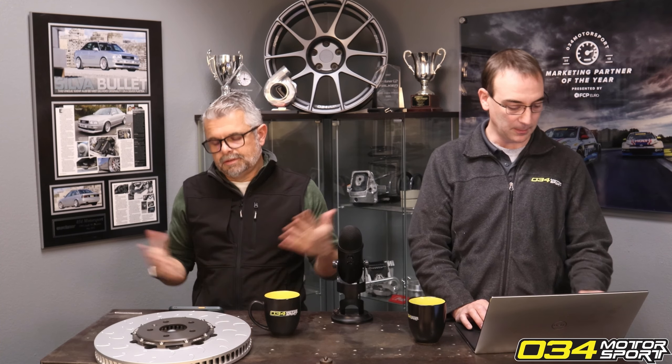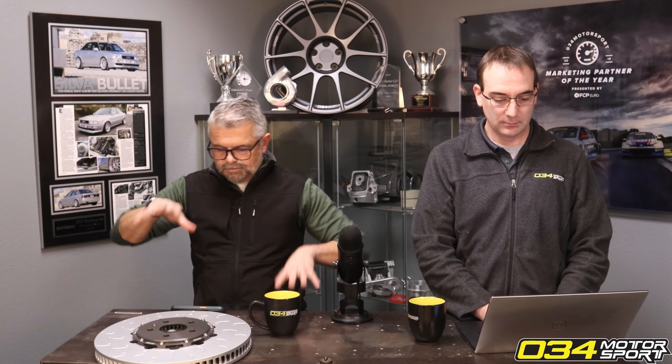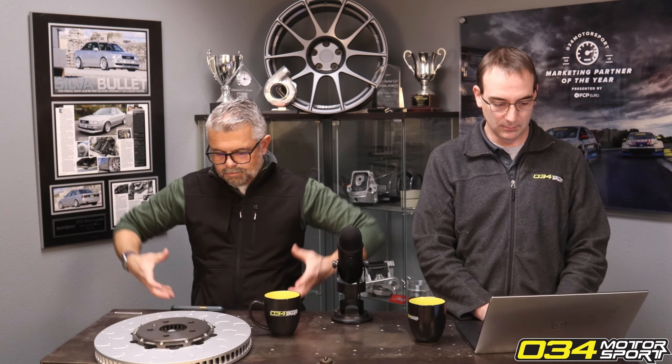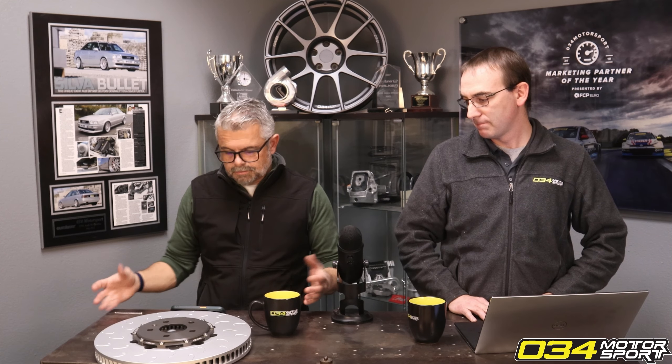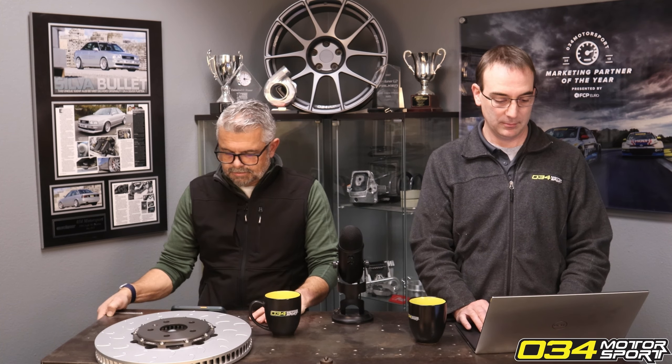You also went E85, so who knows. Generally, bigger diameter tires with smaller sidewalls have less grip. Think about running shoes — tennis shoes have big cushy soles so they can grab the ground and grip. Tires with more sidewall will conform better to the road surface and irregularities, and typically give you more grip. That's not always the case, but there's a reason you don't see people running nines on 25-series sidewall tires.